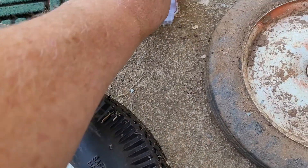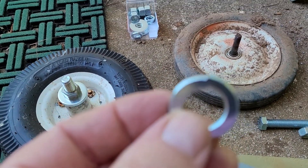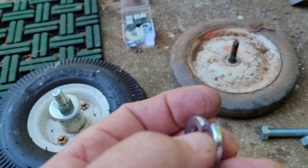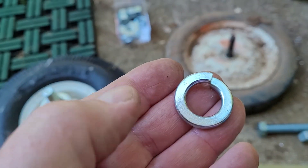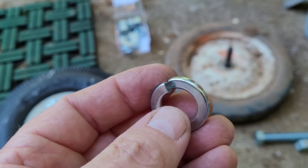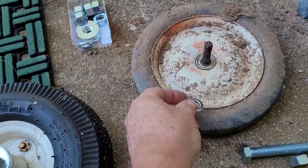For those of you who don't know, we're also going to use one of these on the inside — it's called a lock washer. You can see how the washer is split like that, and what happens is that when you squash down on it, that little edge keeps the bolt from turning. So you can put this on and it keeps the bolts from unscrewing as your vehicle is moving around, rotating, or vibrating. That's called a lock washer.